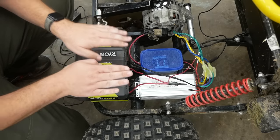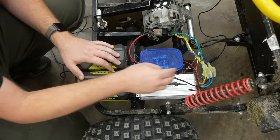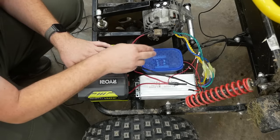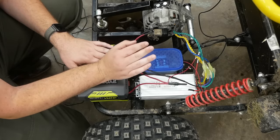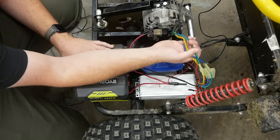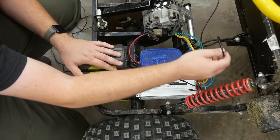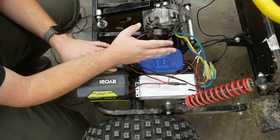The reason I'm using two batteries in parallel is amperage output — one of these Ryobi batteries is only good for about a kilowatt of output, and since my motor controller draws 1.5 kilowatts, I figured I better parallel two of them together. I'm using a takeout container to house the DC power supply that powers the rotor; when I get a 3D printer I'll print something more permanent. I've got my two 40-volt batteries wired in parallel to the motor controller, live wires going into the DC power supply delivering a constant 12 volts at 5 amps into the rotor, the three-phase wires from the alternator connected to the three-phase output of the speed controller, and a throttle temporarily hooked up going to a switch already on the go-kart.